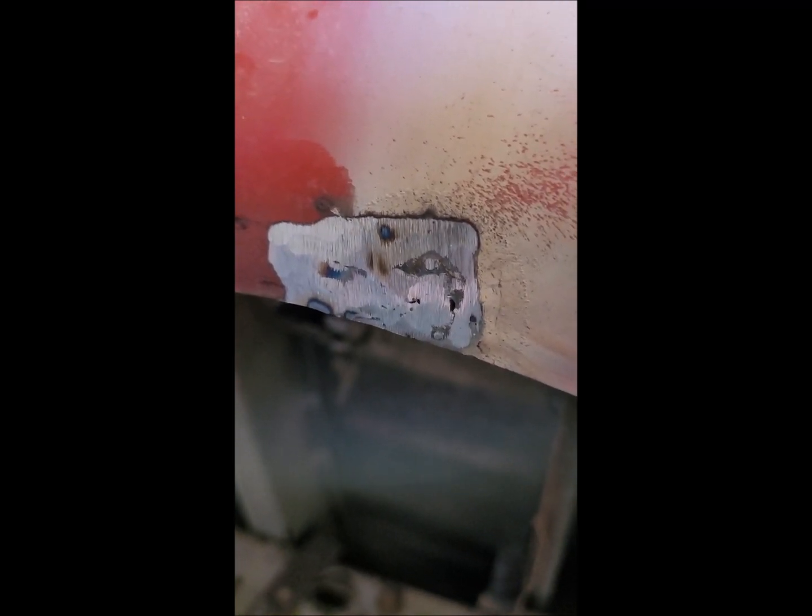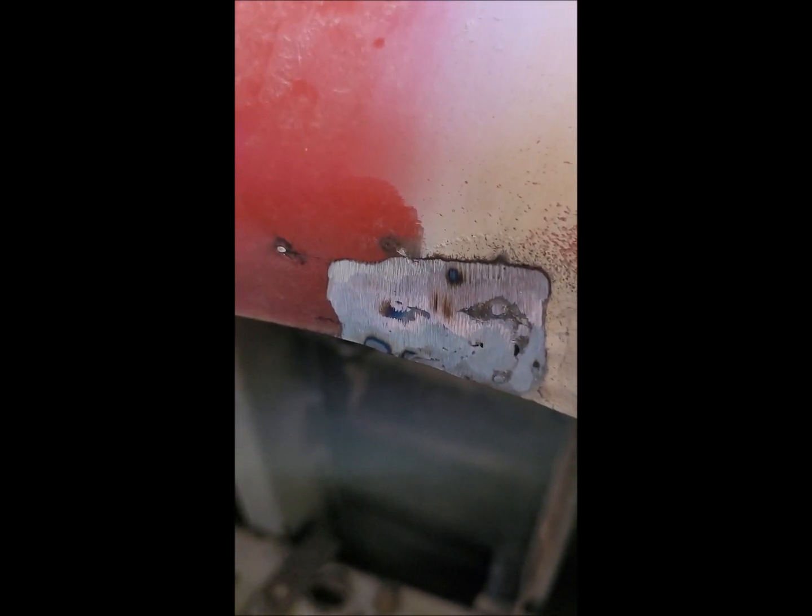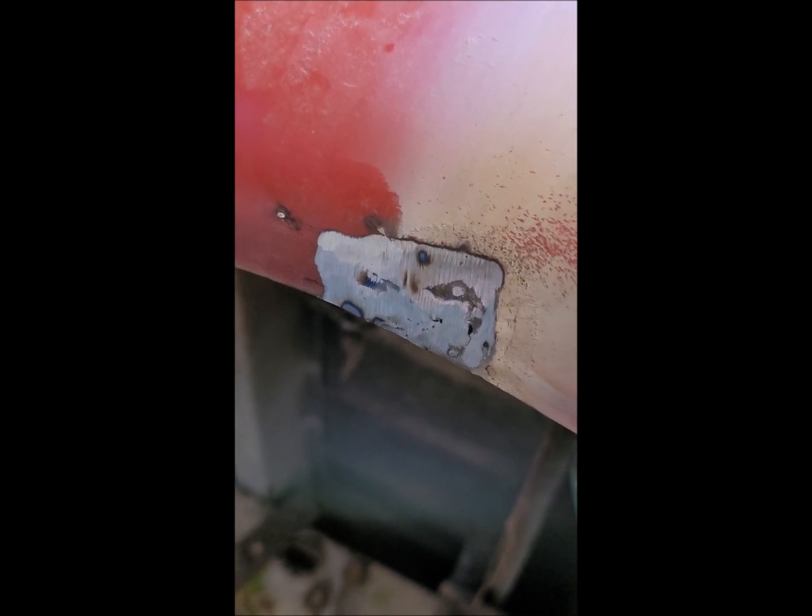Okay, there we go. We got it welded up. There's little pinholes and things, but I'll put a little bit of skim coat of body filler in there and fill that up, and we'll call it done. Sand it off real quick, and whenever I do this stuff over here, I'll take a little bit of what's left over and put it in there. It won't take much. It's not a very big spot, and it doesn't need to be contoured or anything like that. You won't even see it. It's just for my peace of mind and for you guys to see that I didn't just leave it like that. All right, so let's move on to other stuff.